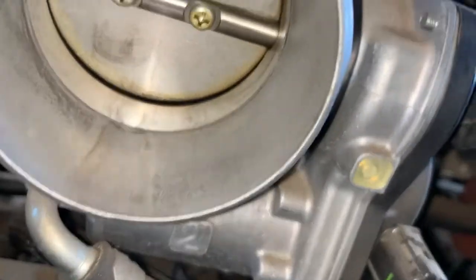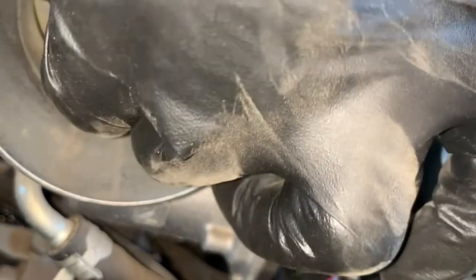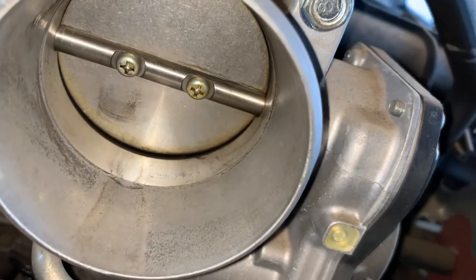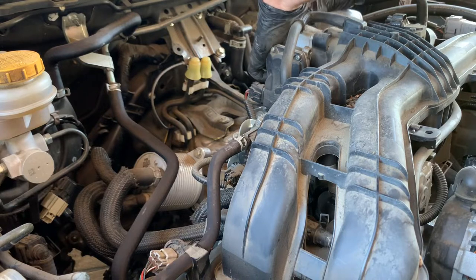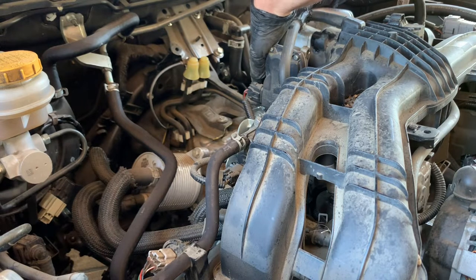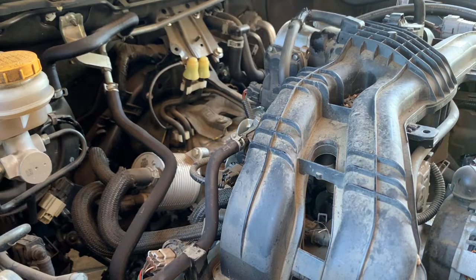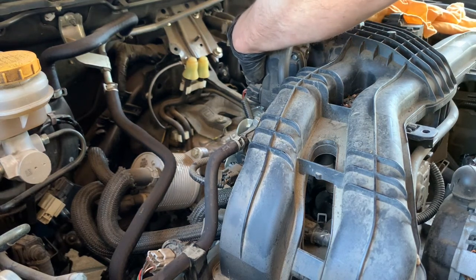This is the throttle body — make sure the ignition is off when you do this. You can manipulate the throttle body with your hands and you can see there's a little bit of carbon built up around the side, though it's not too bad. Now I'm going to hold it open and spray the upper engine cleaner in through here, which should give it a nice even spray throughout the whole manifold. Once that's done, I'll get a clean rag and just wipe all the build-up off the edges of the throttle body.